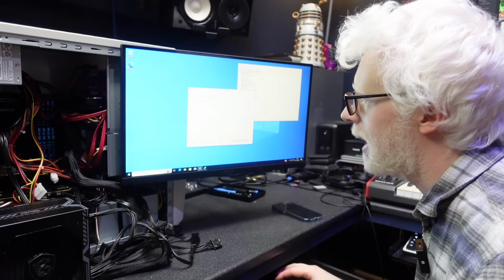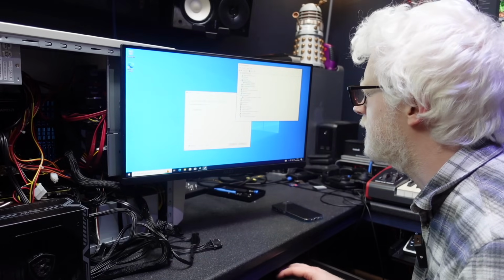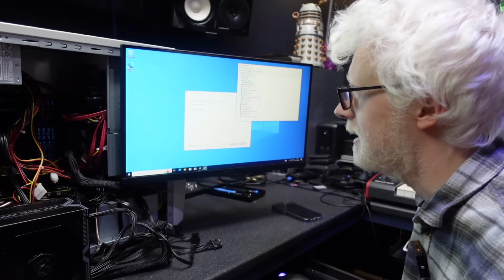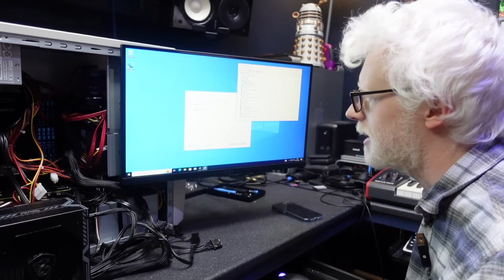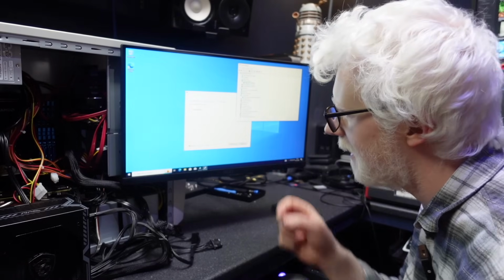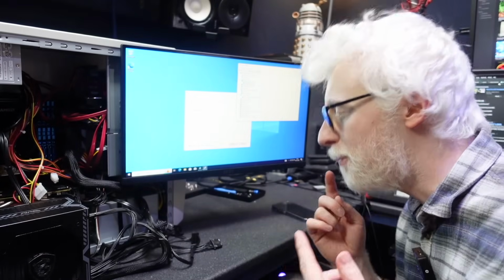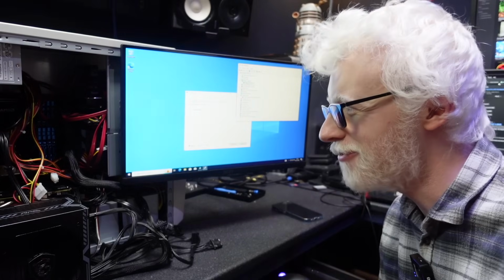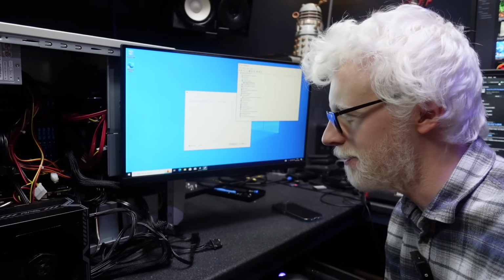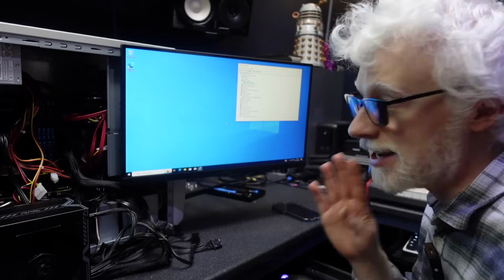I noticed my screen go black and then it came back on. Performance was a lot better graphically, and under Device Manager I can see the RX 580, which is a massive deal. Now whether that will happen in Windows 11 as well, I'm not too sure, but it should. At least now I've seen this, and if all else fails with the video card in Windows 11, I can roll back to 10. But what this is suggesting to me right now is the card was just crippled. It wasn't able to actually power properly in order to get running with drivers. That's my guess so far anyway.